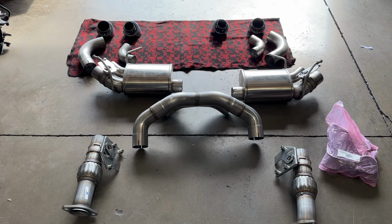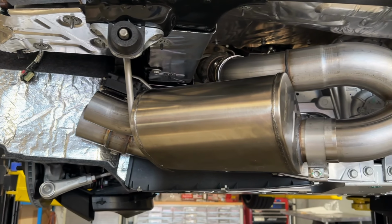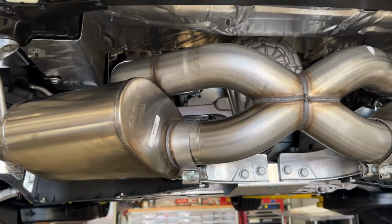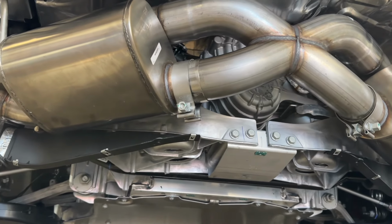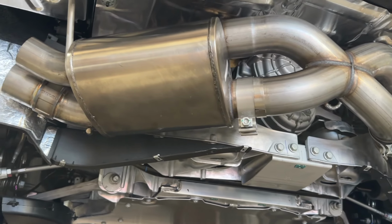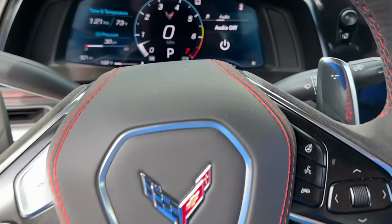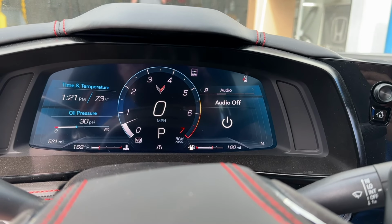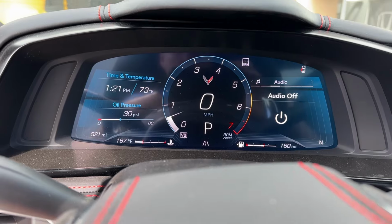We did a Corsa exhaust with a dual mode, where there are a couple of other systems out there that claim the dual mode works with the factory system without causing a check engine light. Our experience, they all flip a check engine light. Even the ones that we've done a relearn function on here, within 50 to 100 miles, the light comes back on. Local dealership has done a couple for us where they've done the relearn with the GM tool.